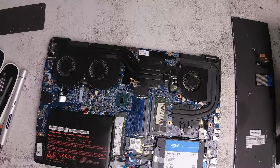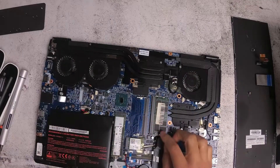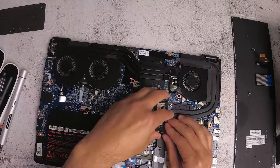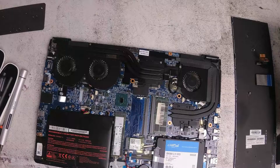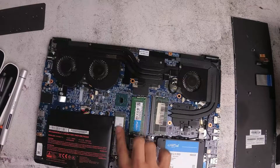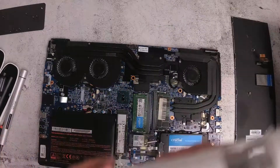That's the memory slot — that's where I'm going to put in the memory module. I'm putting in an extra 16 gigs. This is the existing 16 gig memory module already in there. The one I'm using is the Crucial brand — this one here is also Crucial, 16 gig. So all up it will be 32 gigs in total. Just slide it in — it can only go one way. You'll hear the clip and that's it. There's also the SSD module in there.